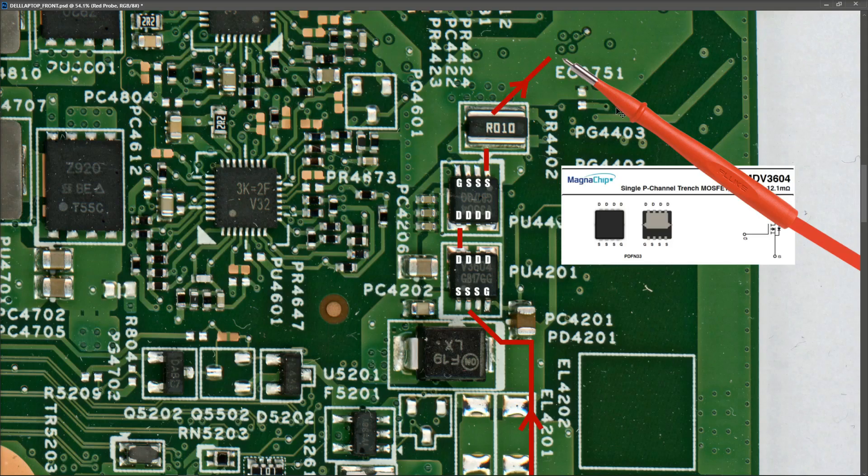I have a proper Dell adapter this week, so I'm going to plug it in, check for the input voltage, and see how far into the laptop the 19.5 volts is getting. The fact that we saw an LED come on at the front suggests the main power rail is probably good and the issue is likely with one of the secondary circuits, but let's take measurements and confirm.